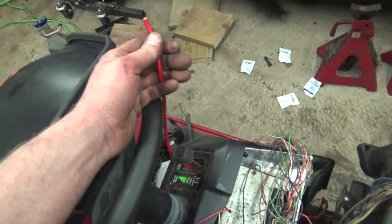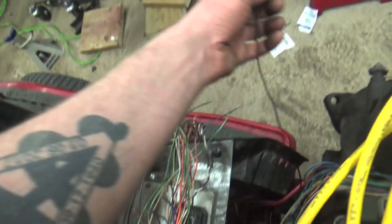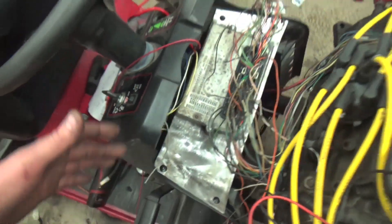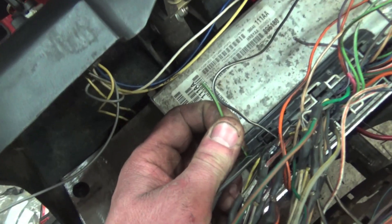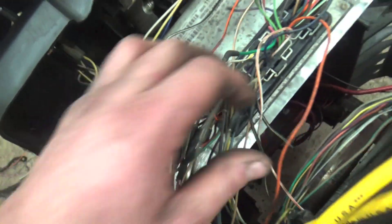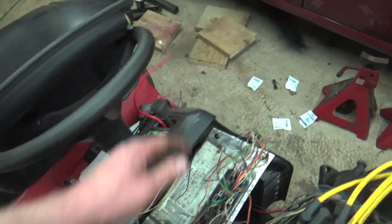This is a giant wiring mess, but this is our constant power right here. We have an ignition run and start power wire, so the ECU will have power even under cranking. Down here we have our constant power to our starter and our starter solenoid power wire — that solenoid is our ticket, that's what's really running everything. We're using the factory ignition switch, so it will still be factory-style run and then crank. We've got injectors, coil pack, and sensors all wired into the ECU. This green-black wire is our run-start power wire, that big red wire is our constant, and we've got a couple of grounds. We have our ASD input power and ASD power running to all our injectors and coil pack.